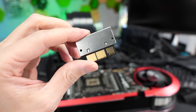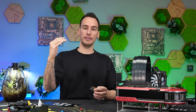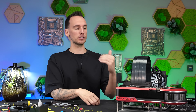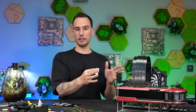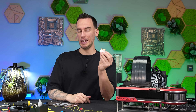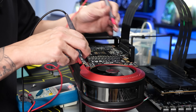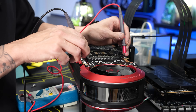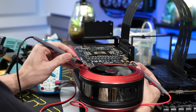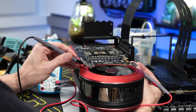One thing you'll immediately notice is that one of the pins is shorter than the rest — that's common practice with PCIe devices. This is the present pin: it's shorter because if the card is only partially plugged, this would be the last pin to make contact, signaling both devices that something is plugged. It might already work just by bridging this pin to ground to fool the card that the BTF connector is plugged. First I have to figure out which of these pins is ground — checking resistance from a known ground point on the card to all individual pins. I didn't find ground on the front side, but the third pin on the bottom is definitely ground.